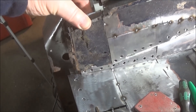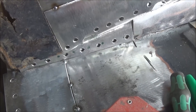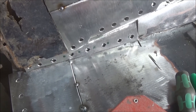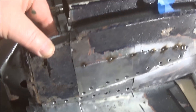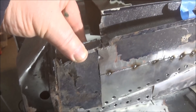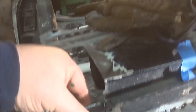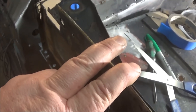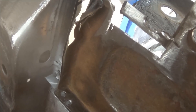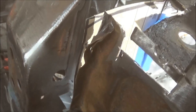Here's a quick look at the old patch we removed from this area — I'm going to have to make the bottom a little bit longer. It's got a flange on this edge and a flange at the top. We'll make up to the flange and the other piece we can make as a wraparound from the top. We've got another patch made with the flange bent on top — it's in pretty good alignment. I've fit in this other piece and it does line up with that flange.